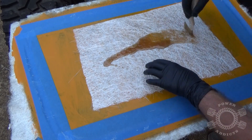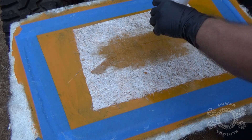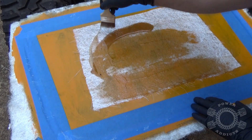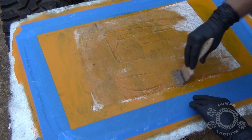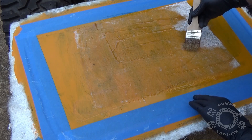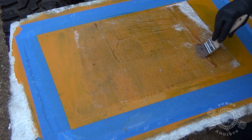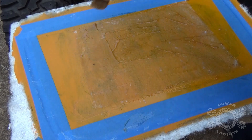So we've got the material laid out, we've waxed the surface real well. It looks like my resin may have some lumps in it — I'm not sure how old this resin is. I bought a brand-new five-gallon bucket, but dad put some out in his bucket so it should be pretty new since he did a boat not long ago. If you get a little lump, just get it off the brush and lay it aside. Now we're going to lay our second coat on.